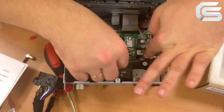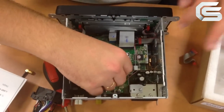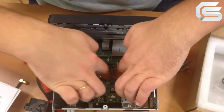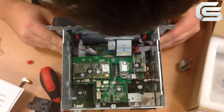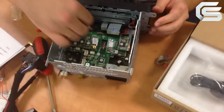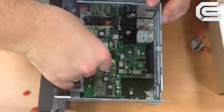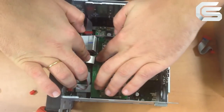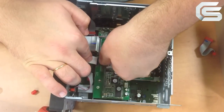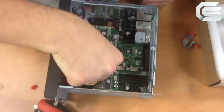Now let's connect this cable. Carefully fasten the wires. Slightly latch the phone part. Then connect the card reader to the mainboard. Put the connector into the socket, then carefully press on the top and latch it. Everything is fastened, everything is connected.